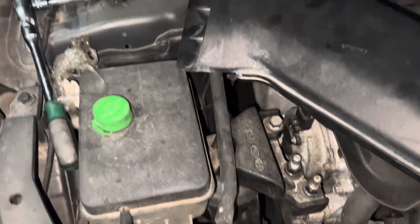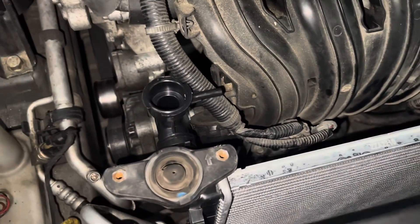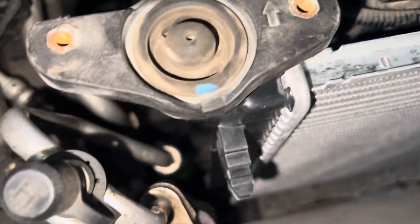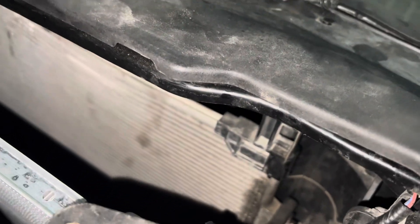You've also got this hose from the coolant tank, which comes on to just over here — it should pretty much just pull off. Fairly straightforward job. Be careful with your AC lines. Now I'm going to go ahead and just clip this in to give you a bit of a clearer idea — those clips are going to go in there and you would just want to get your hand in there and remove those.